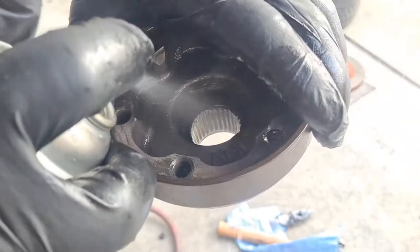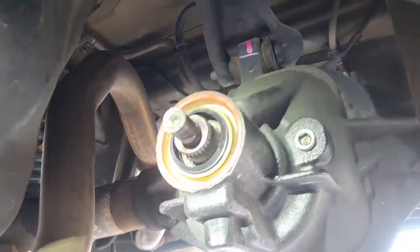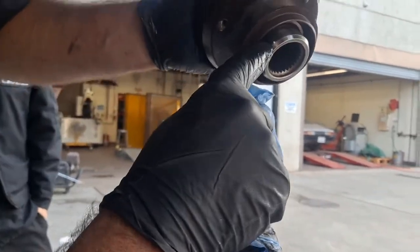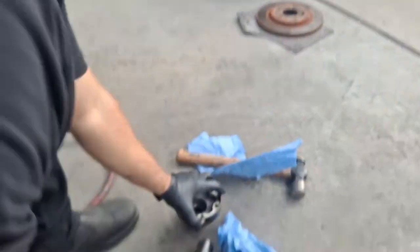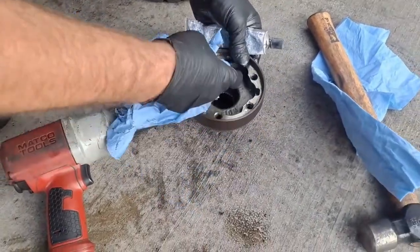Angel, check down here. In those splines, they'll sometimes call for some sealant. Sometimes they'll call for it to be like a PTFE Teflon or something. But I don't think this one does. However, we're gonna show it some love, especially because this seal wasn't leaking where it would normally leak. Down here, it was leaking into this yoke, this companion flange. So I'm definitely gonna seal those splines up. And I'm cleaning the surface, and our surface looks good. So I don't see any defects on this. Like I said, because we're gonna hook it up. Get this a little cleaner. This thing had some goopy goop in there. Some yucky schmucky.